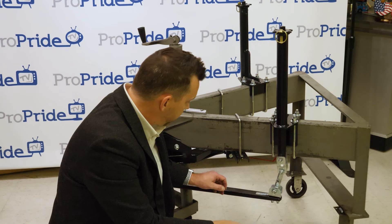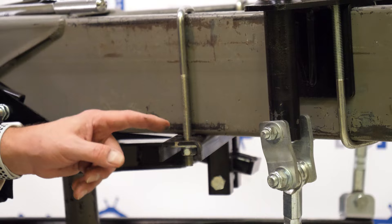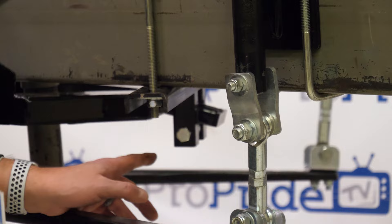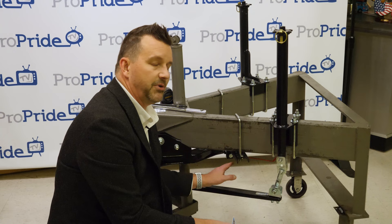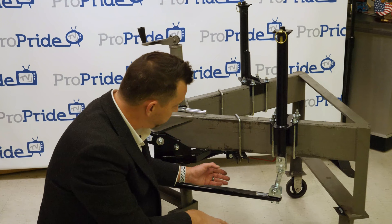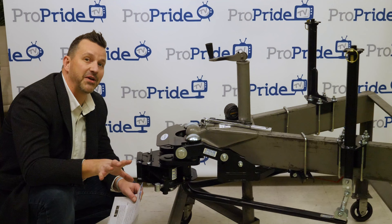For the frame bracket, the goal is to center it left to right with equal distance on each side. Also make sure the yoke tail is centered on the two downward brackets below. If you can't perfectly center it, position it slightly more forward than back. Loosely install it so you can fine-tune alignment when you fit the yoke.